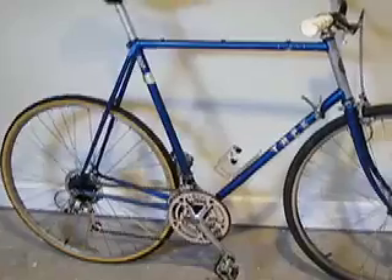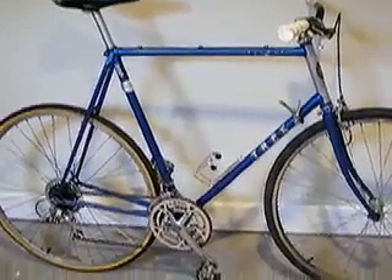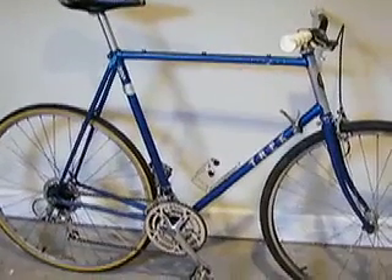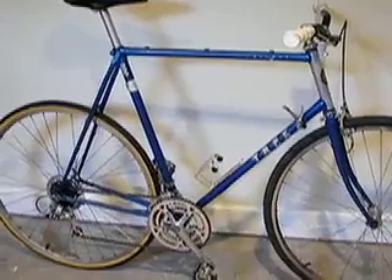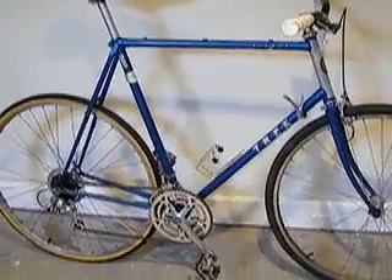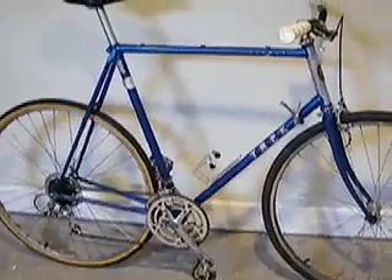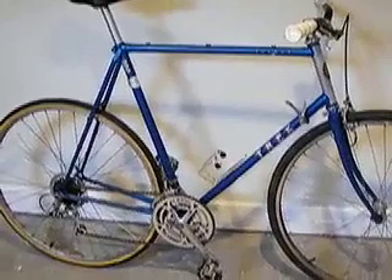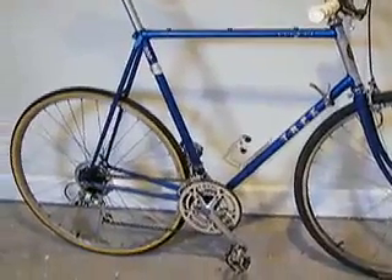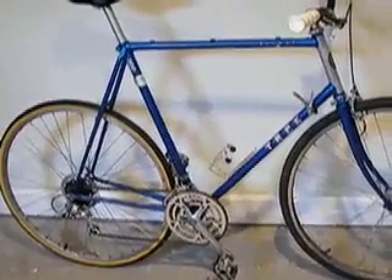Finally I decided if I was going to be able to ride the bike I was going to have to do something, so I started trying to cut it. You obviously can't get a hacksaw all the way down in there, so I took a hacksaw blade and first wrapped tape around it, but that was going to take forever. So what I did was take an old circular file with a wooden handle, removed the file part, and rigged the hacksaw blade into the wooden handle so I had a handle. After hacksawing on it forever, still couldn't get it — it was almost all the way through.